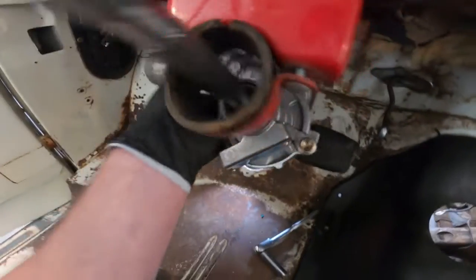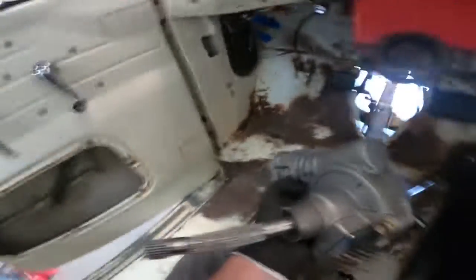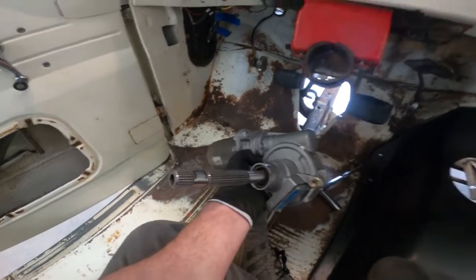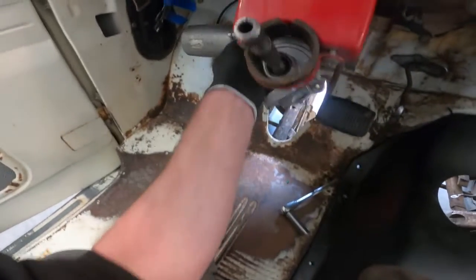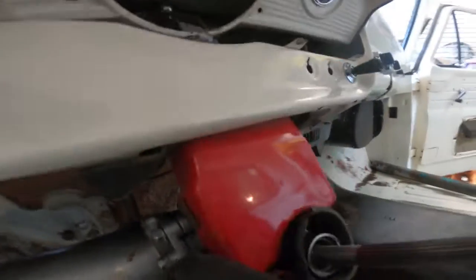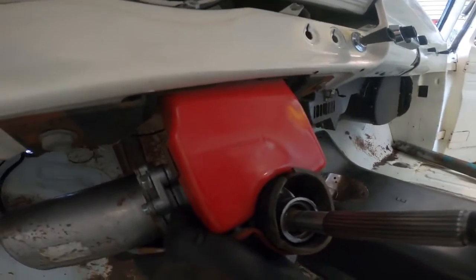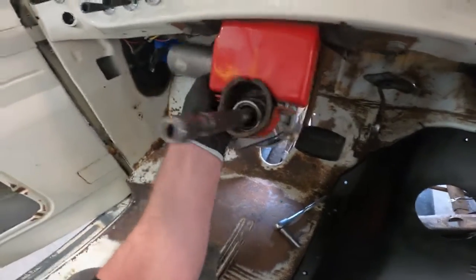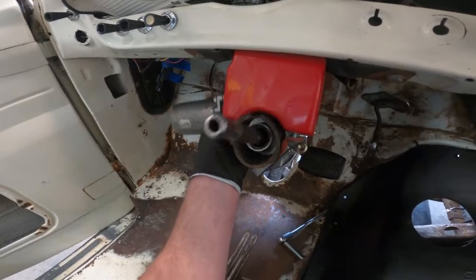What we're going to have to do — that's our tube for the steering right here — we're going to cut the tube, then mount it in. We have bushings that were machined for that part right there. That's where it's going to sit ultimately. We're going to put a bracket right there for that bolt coming off of this already existing bracket, and that's where it's going to get its rigidity from to keep the thing from twisting when we steer.